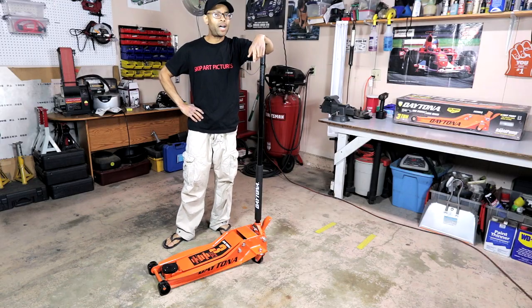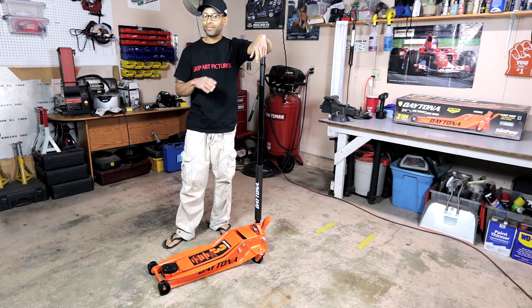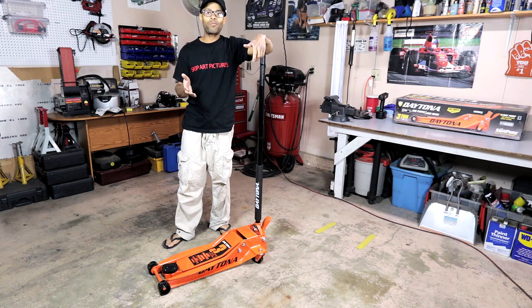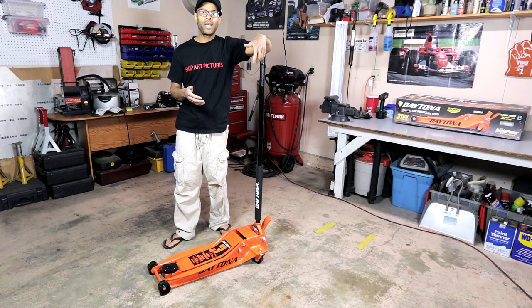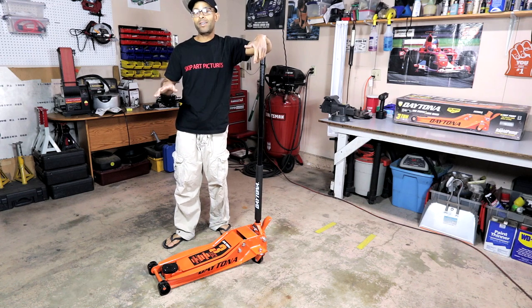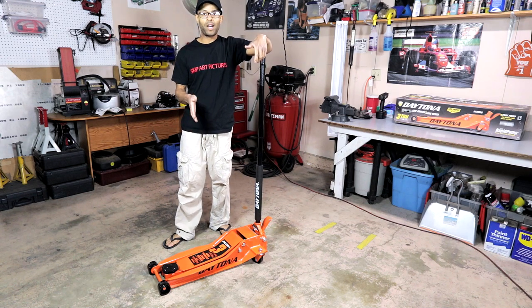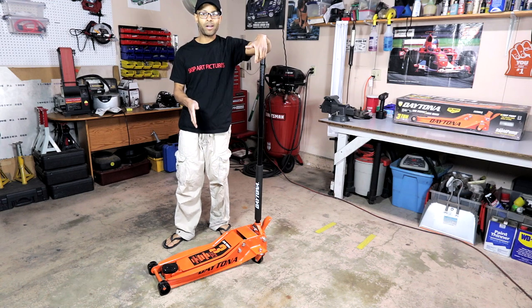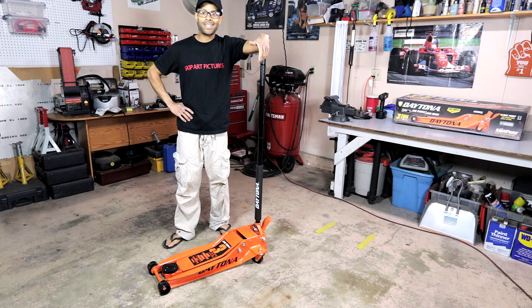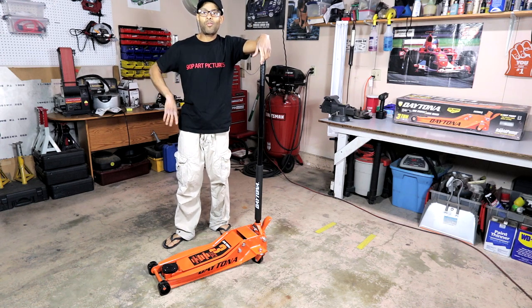And if you have like a Mercedes S-Class or a Corvette, a Honda S2000, something where the cars sit low and you just need to kind of pass that clearance, then this low-profile long reach jack is going to just be better. And those cars are, for the most part, light. The S-Class is a little bit on the heavy side, but 3 tons is going to be more than enough